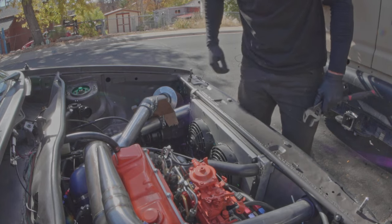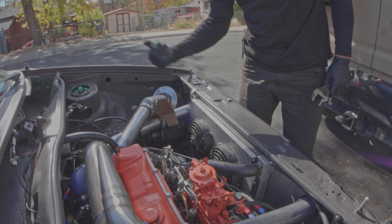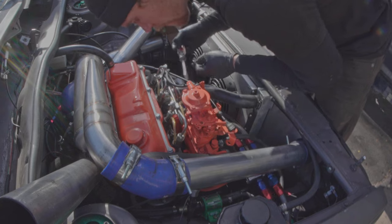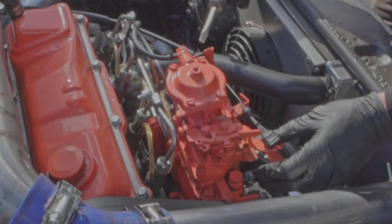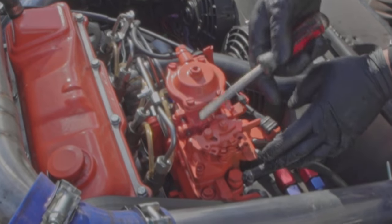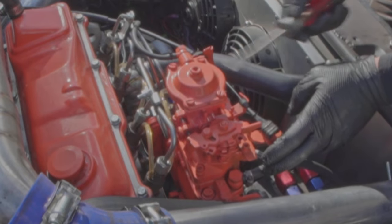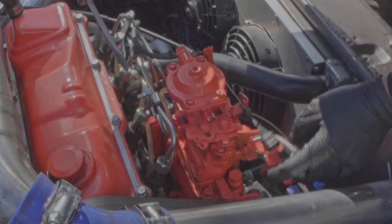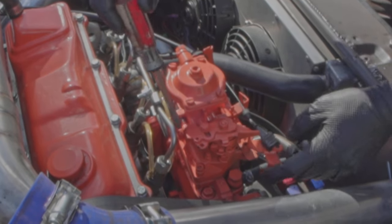Part one, all complete. We replaced the radiator thermostat. This should kick on at a higher temperature now, which means the car won't run as cold. Now, this is the top of your fuel pump. It's pretty self-explanatory if you just look at how the mechanism works: you hit the gas, the cable pulls, this thing moves — that's actually your throttle — and it moves a collar in there that controls how much fuel goes in the engine.